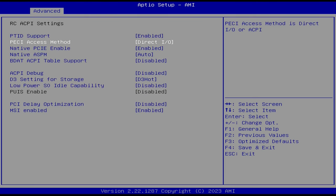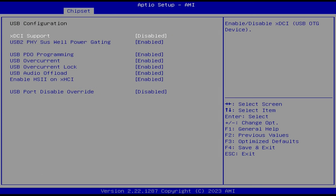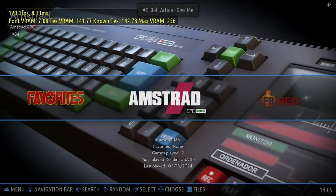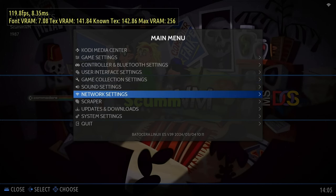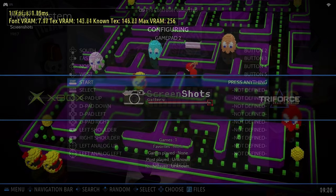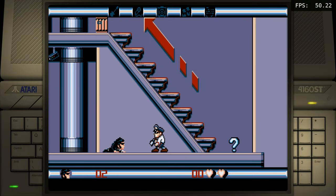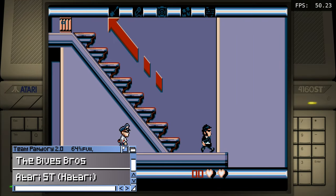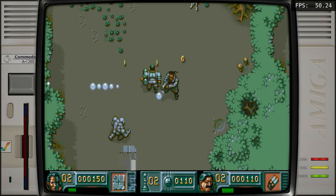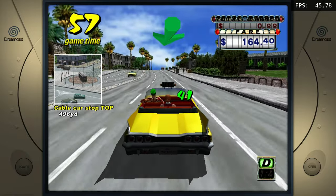Here's the BIOS. We can see that it's extremely comprehensive, albeit overwhelming. It'd be nice if they could put the more important options such as TDP limits, secure boot, and boot order up front, with the more advanced options separated for experts — it's just too much. We then tried our Batocera drive via USB and it booted up without any issues. Batocera is a Linux distro focusing on emulation. We tested out Wi-Fi and it found both our networks, but the signal was weak, so we needed the Ethernet LAN. The Bluetooth controller worked fine. Both the video and audio from the first HDMI port were distorted, but using the second HDMI port was all clear. We played some Atari ST, Commodore Amiga, and Dreamcast — running at 40fps.